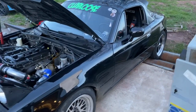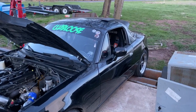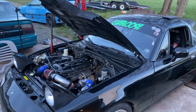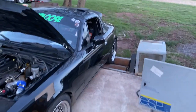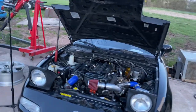I'm going to pull it off the dyno now and take it on a road test. I want to get the acceleration enrichment dialed in — I have better luck doing that by feel in parking lots. And I want to roll onto the boost in various gears on the street to determine if this boost spiking issue is real or was it just something with how I was loading it on the dyno.